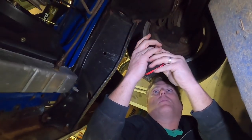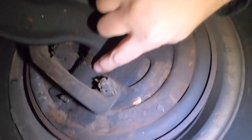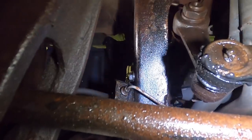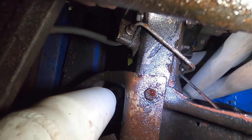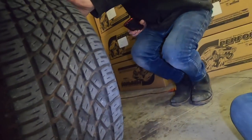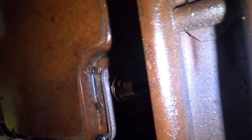While we're underneath, we'll check suspension and steering. This is a kingpin setup — instead of ball joints, it's a shaft the whole assembly spins on. Anywhere there's a ball and socket pivot point, if it's worn it'll have play in it. There's no play there, which is good. But you can see fluid coming out over here — I'm thinking your power steering gearbox is leaking. To fix that we'd replace the whole gearbox; it just bolts to the frame and isn't too bad to do.